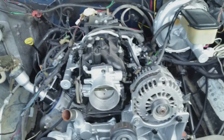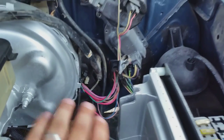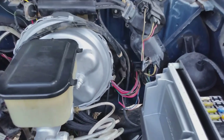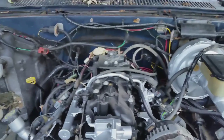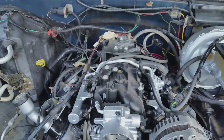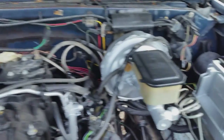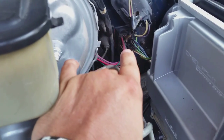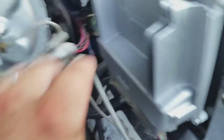The picture in that group will tell you which wires to eliminate. But we're going to do a video because I'm no good at pictures or written instructions — if I see it on video I get it. This will not be a one-day video as I work every day. Rather than cutting the wires off and taping them, I would rather unpin them, just as you do when you make your own standalone harness. I'd rather unpin them, remove them out of the whole harness, put some new wire loom on it, and make it look good.